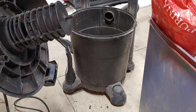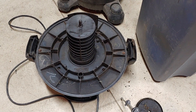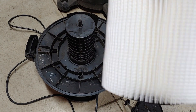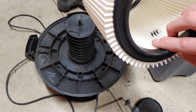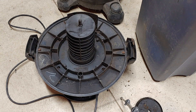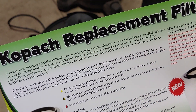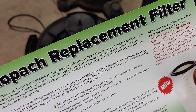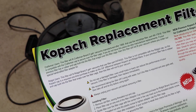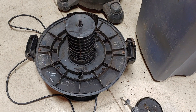If that ever happens, make sure to replace it immediately. Just don't vacuum water with the filter on — that's what you don't need to do. Now, when you've got the filter off, take the new filter. This is what the new filter looks like. It has this mark here if it comes from the Copac LLC. It says here that the part number — the hash symbol 9-17816 — matches the part number from the manual. It replaces 5-gallon-plus vacuums. I think this is an 8-gallon, manufactured after 1988. They used the red stripe filter, and it gives the part number.